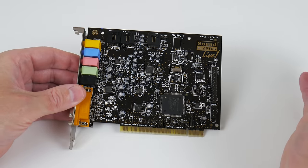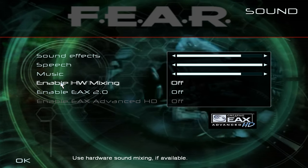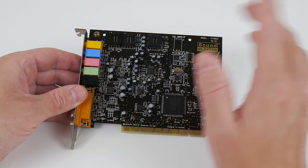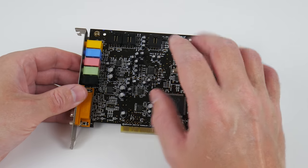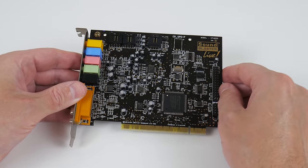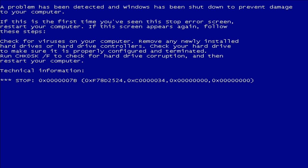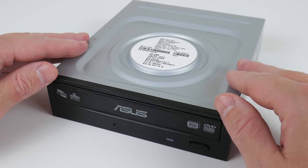For sound we can't go wrong with the Sound Blaster Live. Even under Windows XP you can enable EAX in many games. Under Windows 98, be aware that if you're comparing benchmark results you will get higher FPS without a sound card — quite significantly actually, so keep that in mind. Win Setup from USB unfortunately didn't work on this computer — we're getting a blue screen — so once again I'm using a SATA optical drive and installing Windows XP from CD-ROM.